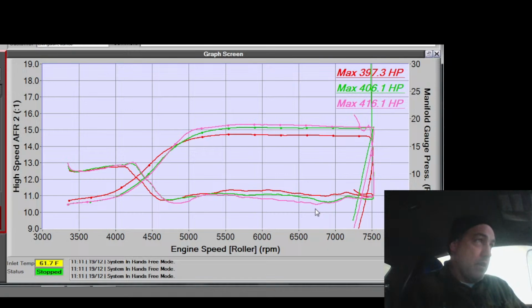40 or 50%, that's doable. Now, if your engine was higher compression, like I run 9 or 10 to 1 in my cars, especially at 10, it's a lot easier. Still hard, but easier. If that's what you're talking about, that's the only issue I can think of. I don't know what else you mean by running it in below freezing temperatures being an issue that can't be fixed by a tune. So the only thing I can think of is starting, because once they're running, it's good.